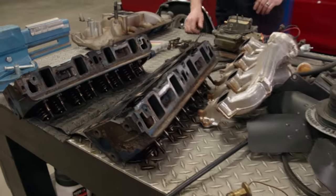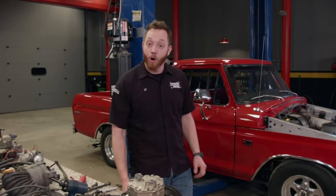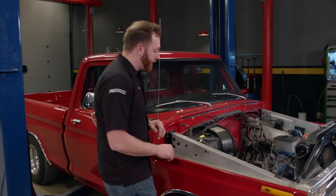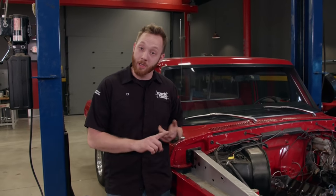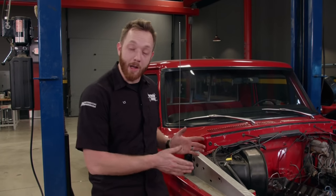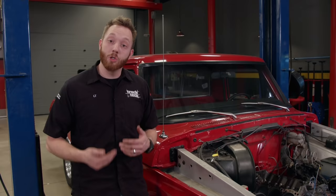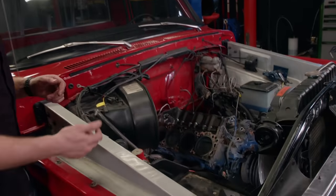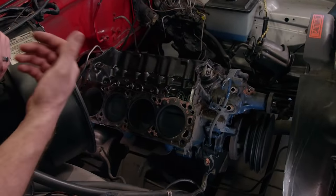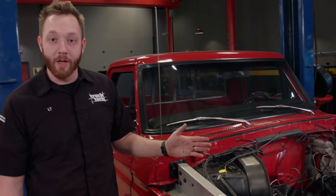It's always a little nerve-wracking taking apart an older or higher mileage engine — you never really know what you're gonna get. Our short block is in pretty decent shape, but there is a small ridge at the top of each cylinder wall. Basically, that means our engine is a little bit worn and has some miles on it. But the good thing is this engine didn't smoke and it didn't burn any oil, so it'll be a good candidate for a mild build. If we wanted to pump this up to 500 or 600 horsepower, we should probably pull the engine out, machine it to accept an oversized piston, and clean up those cylinder walls. But again, this is just a mild build, and it also saves us a little on our budget. It really wouldn't save us that much more time to pull the engine out for the heads and cam swap, so we decided it's just easier to leave it in there.